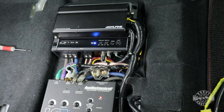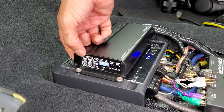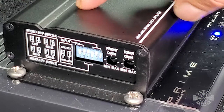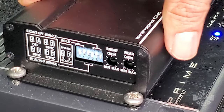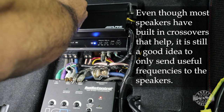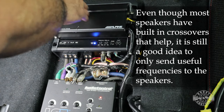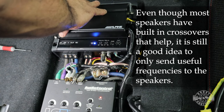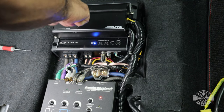I could clearly hear the distortion when I went too far, and I backed it up. So theoretically my gains should be pretty good. I do want to mention something about this inline amplifier — it has a high-pass filter. Because we're not driving subwoofers with this inline amplifier, I don't want to send very low frequencies to my speakers that could possibly damage them, since the speakers are not meant to reproduce sub-bass frequencies — that's what the subwoofer is for. I want to set the high-pass filter above the minimum that my speakers play. You can look up the specifications of your installed speakers and go above it. I have mine set to 80 Hz.